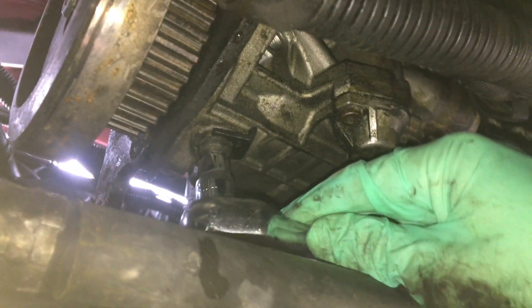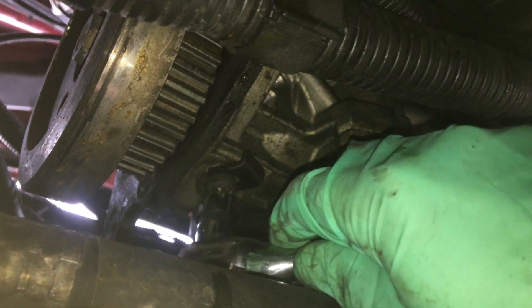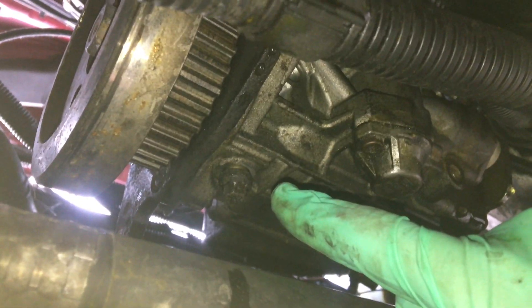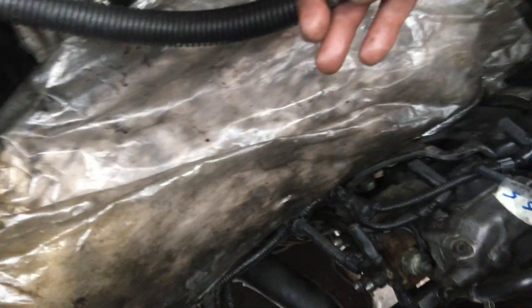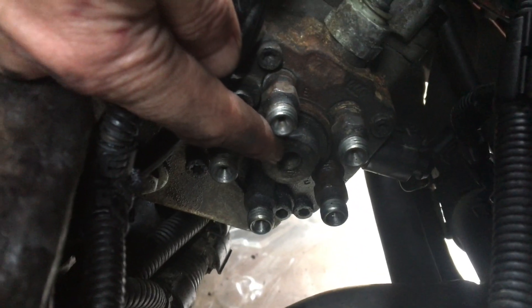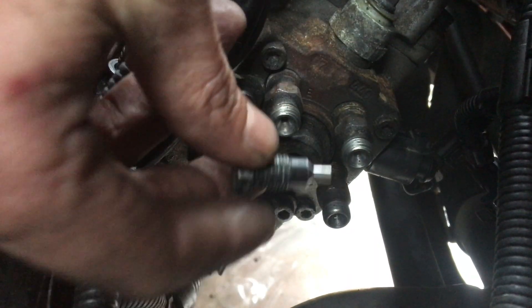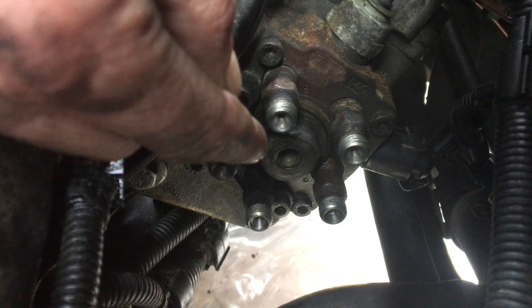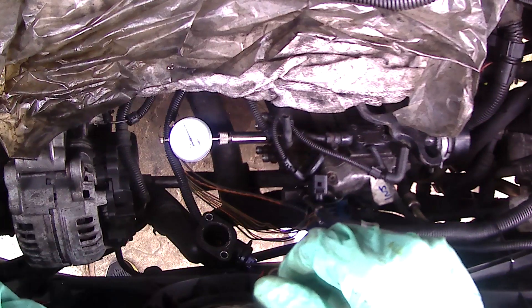Right, let's go time up the diesel pump. First thing I'm going to do is get underneath the engine — there's a 10mm bolt here I'm just going to slacken off a little bit to release that little clamp, and leave it loose so that once I've found the position the pump needs to be in I can then tighten and lock it off. The next thing is to remove the center bolt and the copper washer — unfortunately there was no copper washer on there, along with a list of other things not refitted to this van.